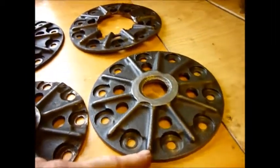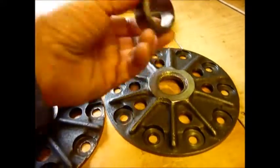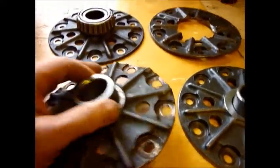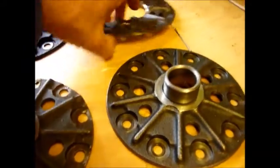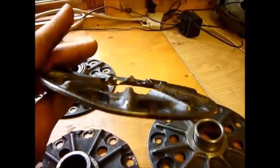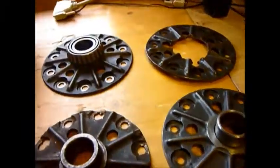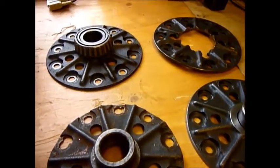Now this is a casting and as a casting it's quite a weak unit, so to tear this off the end is quite common. Equally, you can see that it's quite easy for it to have lumps torn out of it, and part of the reason is that it is extremely thin where it bolts through with the crown wheel bolts. They also have a tendency to flex and tear the centres out because it's really not a very strong unit - a combination of poor quality forging and age-related wear.